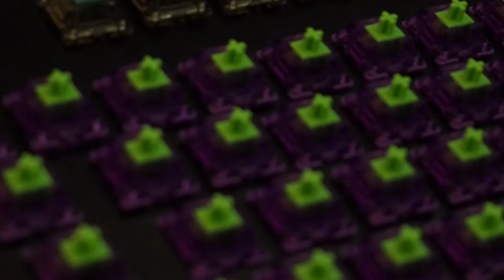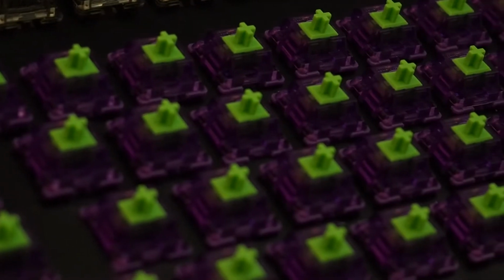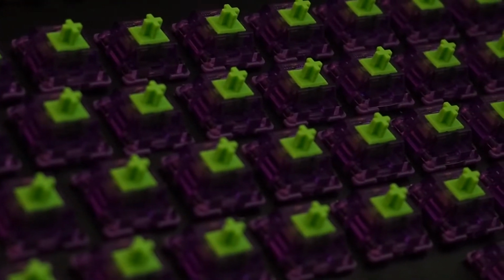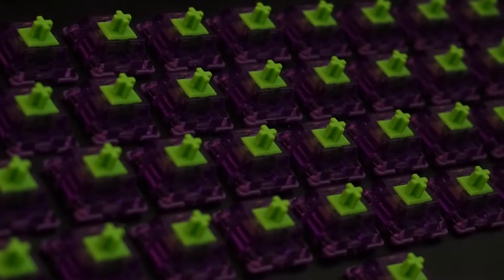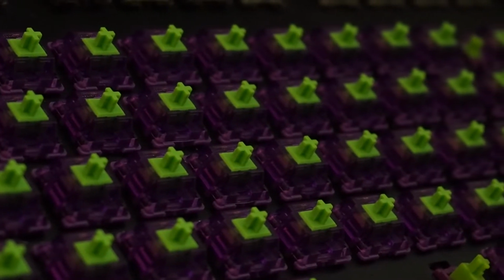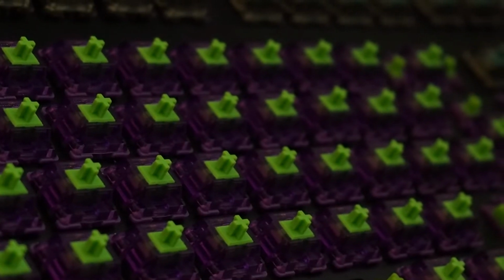Joining these purple and green keycaps are the Shogoki switches. I got these well after the group buy, from them being in stock on Prototypist, which is actually where I got the Krytox 205g0 to lube these switches. It was my first time lubing, and with the amount of free lube I got, it was definitely an exercise in less is more. I originally planned to lube this with Tribosys 3204, as it's a thinner lube that's better suited to tactiles, and it's easier for a first time lube job like this. Unfortunately, my order of Tribosys is being held hostage by the GMK Civilizations order I made back in March, so that won't be here until December.